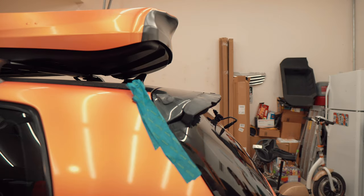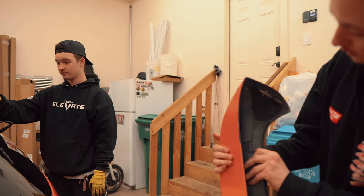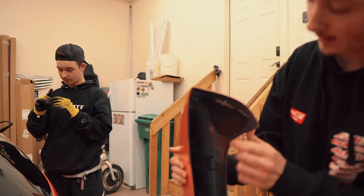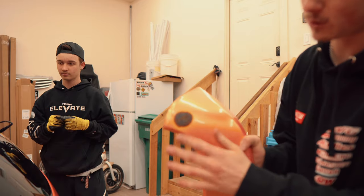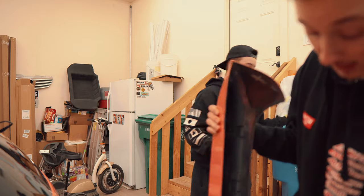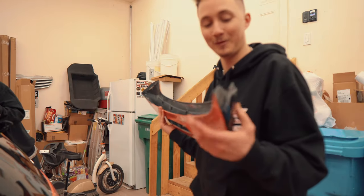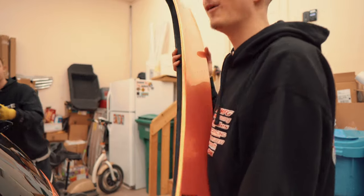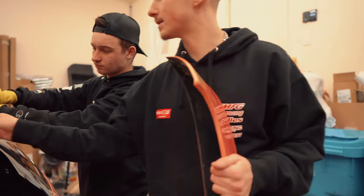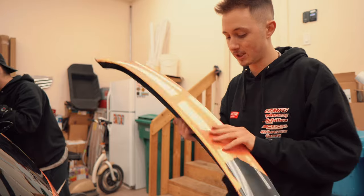And that is the stock Golf R GTI wing removed. You can do it in one piece — look, I did it over here. We honed in the heat right there, you can see where we just melted the wrap right on that corner, and then we just lifted it up with the screwdriver. So you can keep it in one piece. If you guys want to buy this OEM part, it's in perfect condition on that side. Now we just need to figure out how to get this scaffolding or bracketing off — that's how you remove the stock wing off the Golf R GTI.